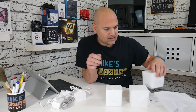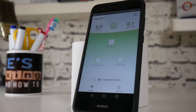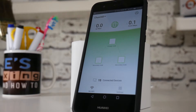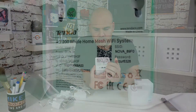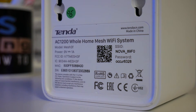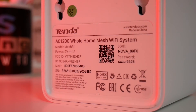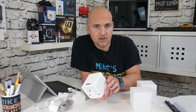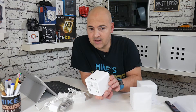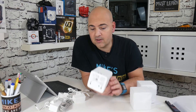When you set this up for the first time there's an app you can download on your phone, or alternatively to keep things super simple, all you need to do is make a note of the Wi-Fi address and password on the bottom of the unit. Then plug the WAN socket into your Virgin Media or Sky box — basically your incoming internet feed goes into the WAN socket — plug it into the mains and that essentially is it. All you have to do then is connect to the Wi-Fi listed on the bottom, put in your password, and you're connected.